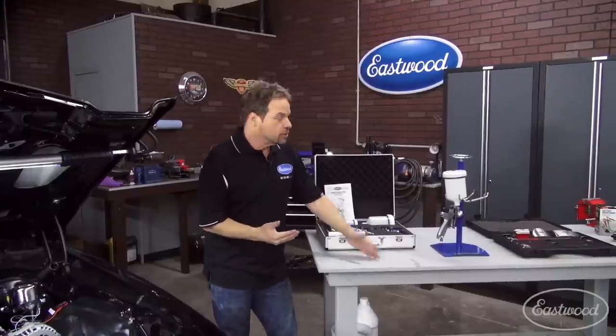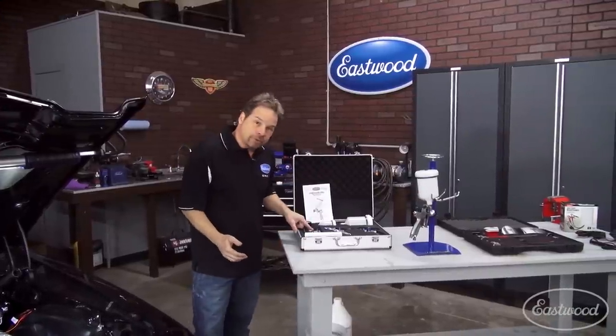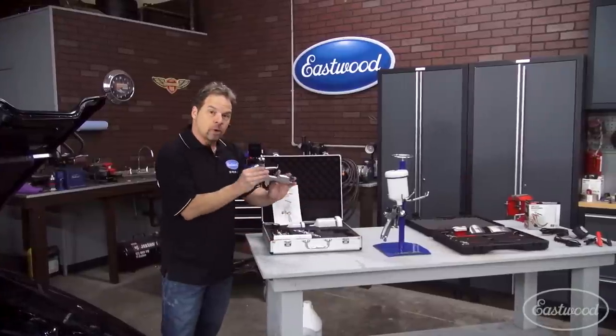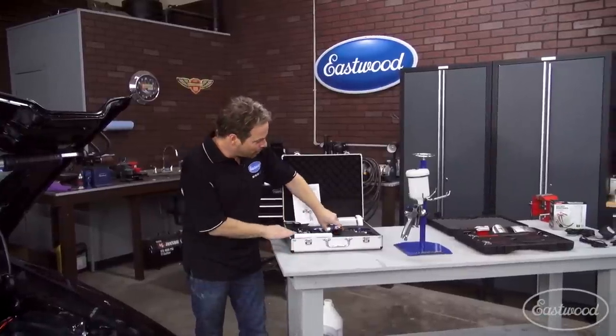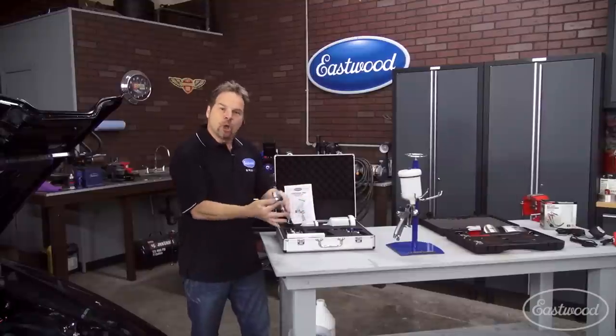I don't need three guns. With the Concourse Pro set, I've got a 2.0 fluid tip, I've got a 1.7 fluid tip, and it comes loaded with a 1.3 in the gun. So you could say I've got three guns, but I don't. I have four guns because it also comes with the minigun with a 1.0 fluid tip for smaller, tight areas,